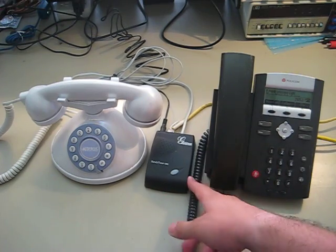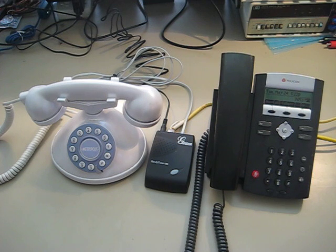How these work is you plug it into your Ethernet and then you can visit their IP address in a web browser and configure the settings for your user account and password on either your own VoIP server like an Asterisk server, or on one of the free ones like sip2sip.info. Then, just as normal telephones can call each other, with these you can call each other with the advantage that it's free.